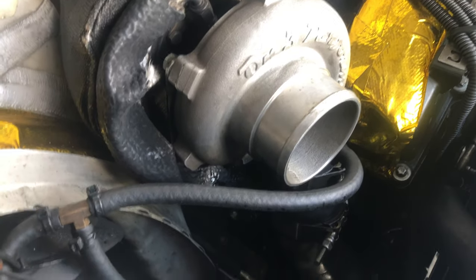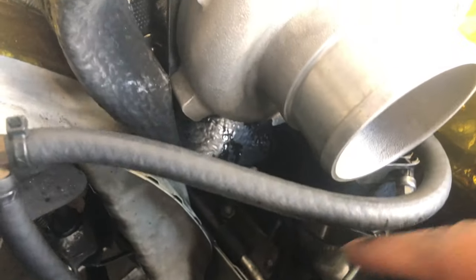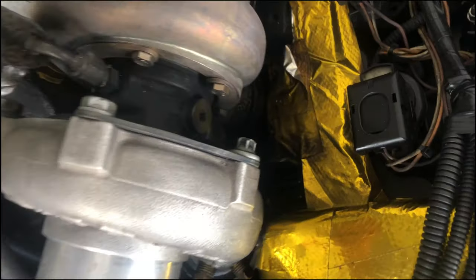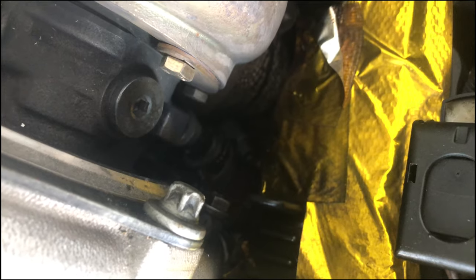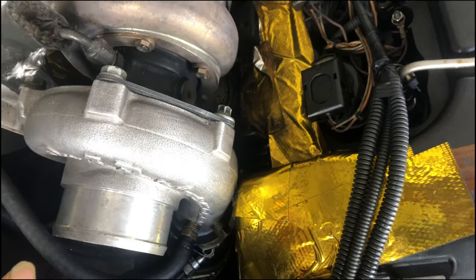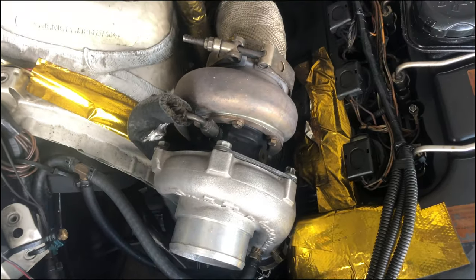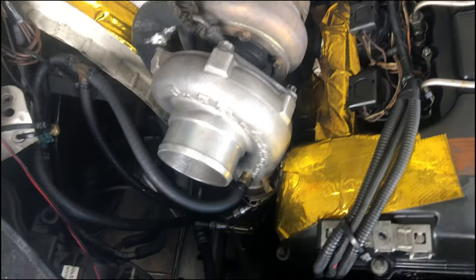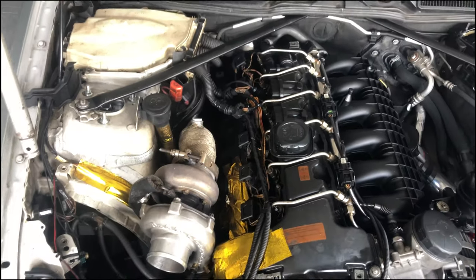You can see the smoke — it seemed like it's coming from over here. Cooled down a little bit, so I took off the turbo blanket. Still a little hot, but I noticed there was some oil leaking onto the oil drain area, so I'm most likely going to have to look into that. What I'm going to do is not today, but tomorrow I'm going to go ahead and take off the turbo and drop the lines.